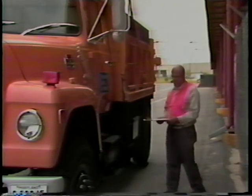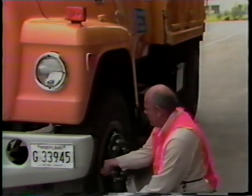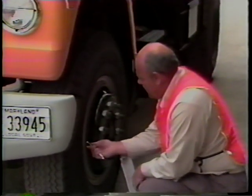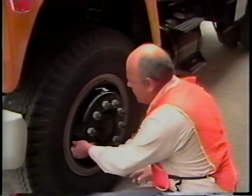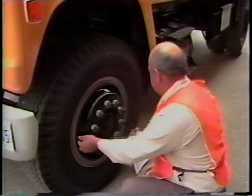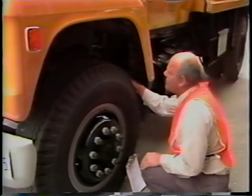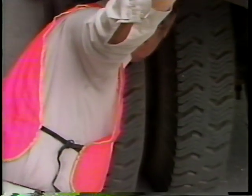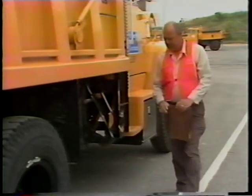The pre-start check is a walk-around inspection for damaged or worn parts and fluid leaks. It also includes fluid level checks. Check the air pressure of your front and rear tires. Be sure all valve stems are equipped with valve caps and that they are securely screwed down. The truck manufacturer should give you the recommended tire pressures for your make and model dump truck. Also check the tires for wear and damages such as cuts, radial cracks and sidewall damage. Remove any stones embedded in the tire treads and check for rocks that may be lodged between the dual rear tires. Rocks lodged there can cause tire failure. With the added weight of material in the dump body, a tire problem could cause you to lose control of your truck.